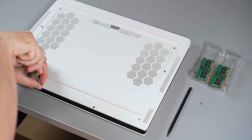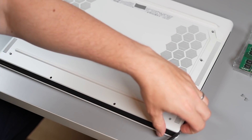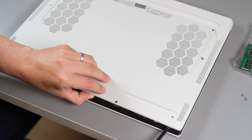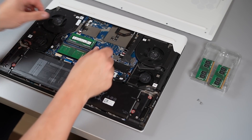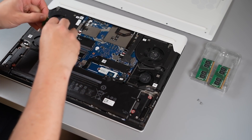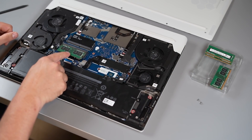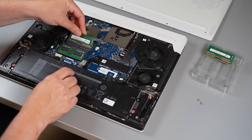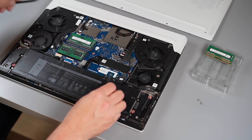Installing the RAM was very easy. You just remove 8 screws from the base plate, most of which are captive. The front left and front right screws also separate the base plate enough to allow you to pry the panel from the chassis with either a pry tool or your fingernails. Before you start working on the laptop, make sure you disconnect the battery. The RAM is readily accessible — release the metal arms on either side of the memory stick and gently slide the old chips out. Make sure when you install your new RAM modules you insert them in the correct orientation and at a slight angle, pressing down so that when the RAM is seated, the metal arms clip in place. I've put a link in the description for the crucial low density RAM modules with decent timings, as I've used.